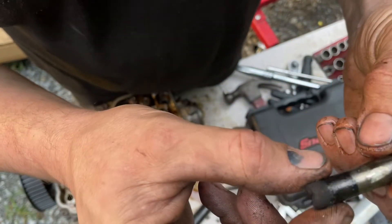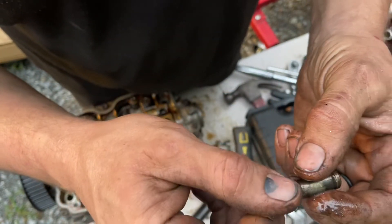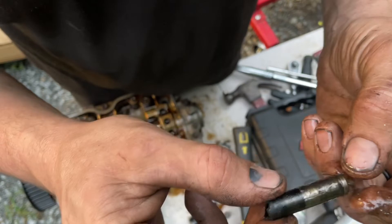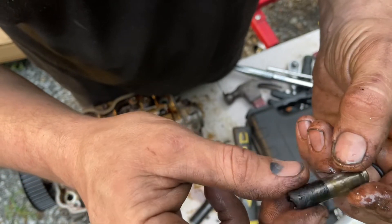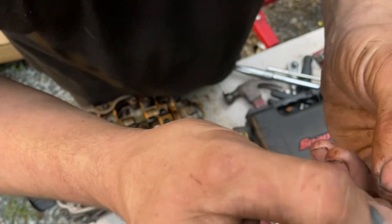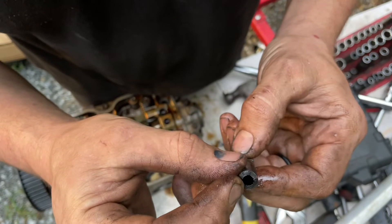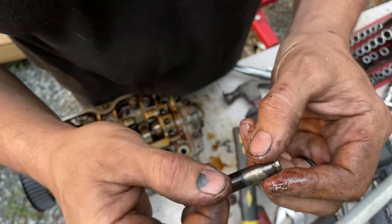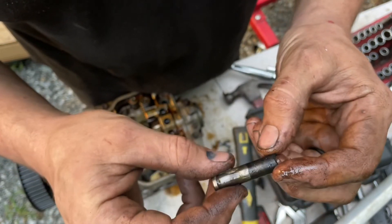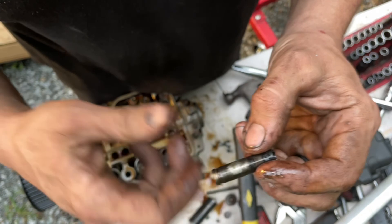It stuck my valve open. Right here's where your seal goes on — there's a little groove right here for your seal. So I've got to go get another head that I've got in a vehicle, take the valve guide out of it, and hopefully that hole is alright so I can put it in my head with a used valve guide. You can see how hot and brittle that got — that thing shouldn't break and be brittle like that on the end. It got so hot it essentially melted. I'm guessing that was because I had open exhaust on it for a while, and it just finally ended itself. So I've got to get a valve and a valve guide and we'll put it back together. I'm going to take y'all with me.